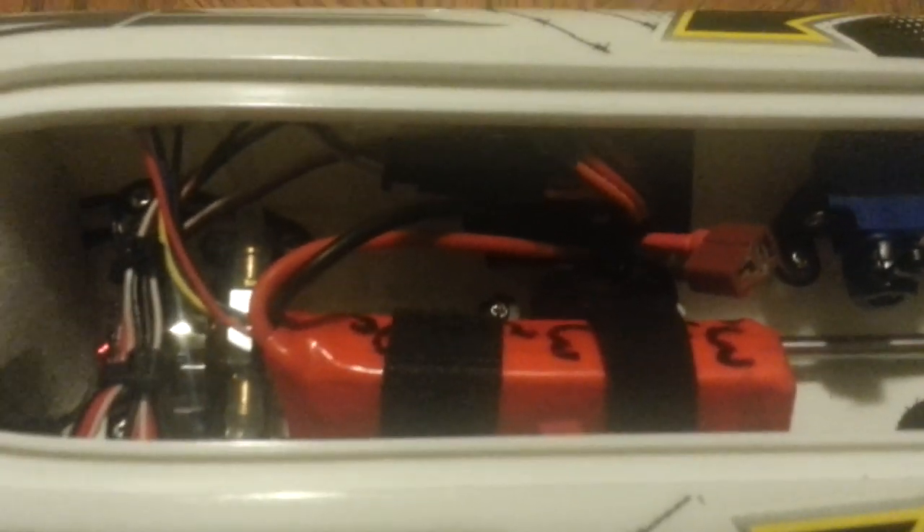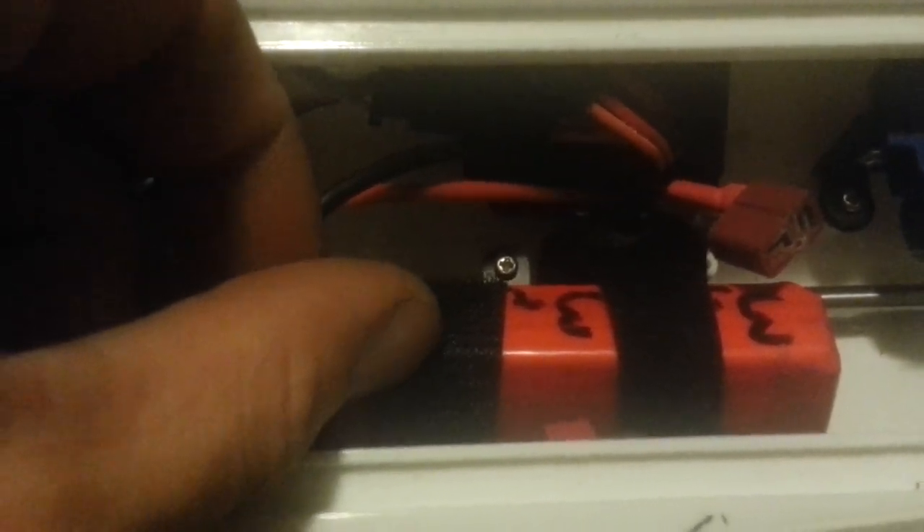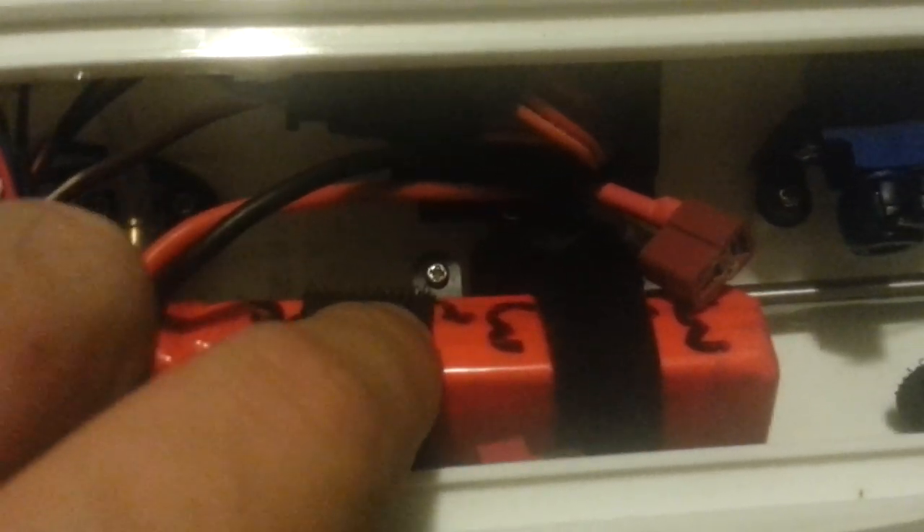What I noticed is that the boat likes to sit on the side a little bit, leaning to the left. So what I did is I modified this tie-down strap so that the battery will actually stand up. I put some velcro on the battery along here and on the bottom side, so I can get the strap to go over and keep it nice and secure towards the middle of the boat. That keeps the boat more centered for better stability in the water.